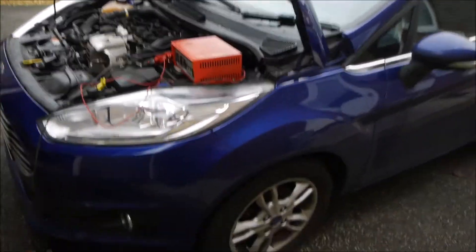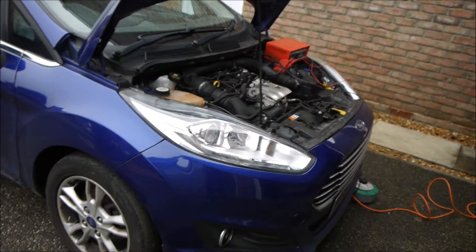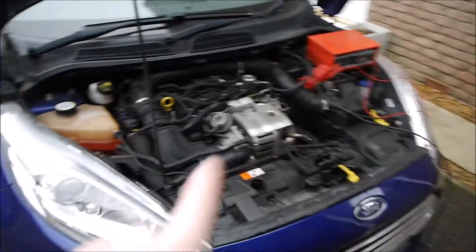You may spot the first problem: it's got a flat battery. It's run about 102,000 miles, no body damage, not Cat S, not Cat N, nice and straight, nice and clean inside. But the real thing is the engine. I don't buy anything that works well - I always buy something with a problem for a challenge. This has got the classic death rattle of an EcoBoost, which has a wet belt - basically a cam belt running in oil. At 100,000 miles in hot oil it starts to degrade, the bits get sucked up into the pump's gauze, the pump then can't pump oil around, starving the top of the engine and causing a horrible death rattle noise.